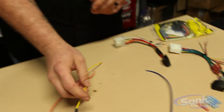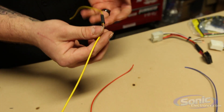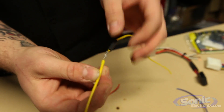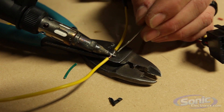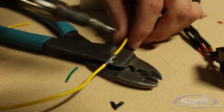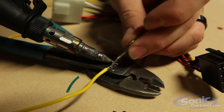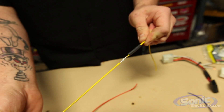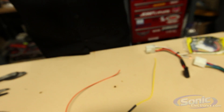Last but not least, we have our soldering heat shrink which is actually one of my favorites because it provides you the best connection possible. I have pre-soldered the actual wire before I heat shrink to give you a nice example of what it actually should look like. When you solder a wire, when you actually twist the wire together and you heat up the actual copper, you want to make sure the solder soaks all the way through. It's not a dab, not half the wire, because that's not going to give you a nice, solid, true connection. Here we have the solder and heat shrink — it's a very nice, solid connection. I'm not going to be able to rip that apart, unlike a butt connector, which I may be able to just like that.